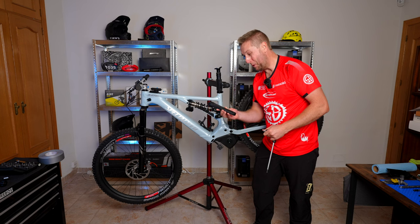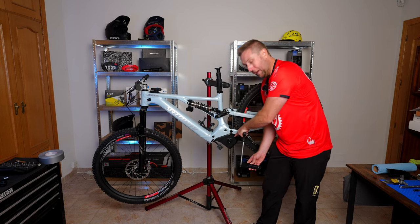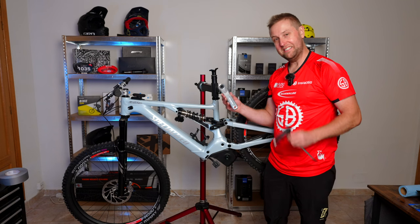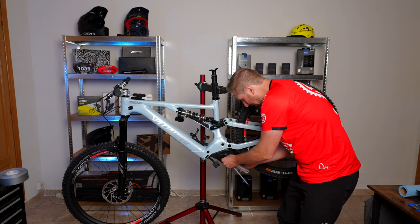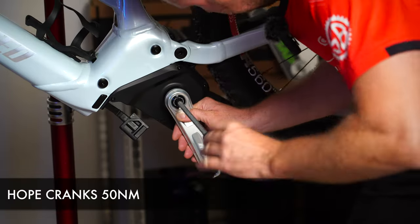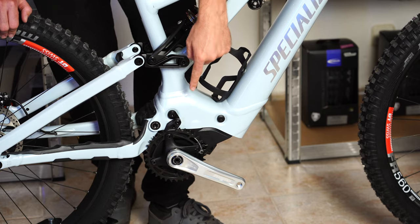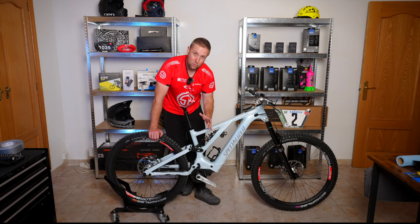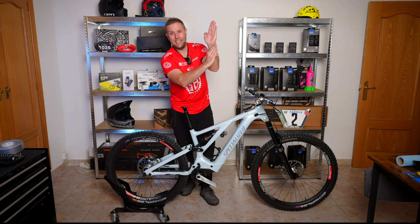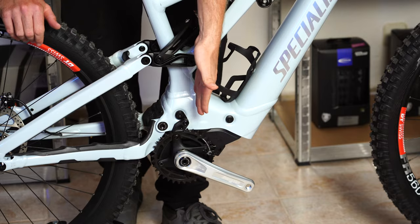The crank is off. Because this is a brand new bike, it still has grease on there — normally I'd clean and re-grease it, but that's all right. We get the new crank and put it on, then tighten it up. We've taken the bike out of the stand to install the second crank. One thing to look for: make sure it goes exactly in line, as it is possible to get it a little bit off.